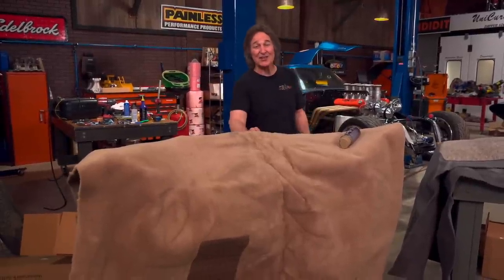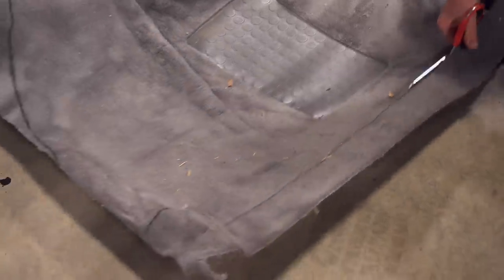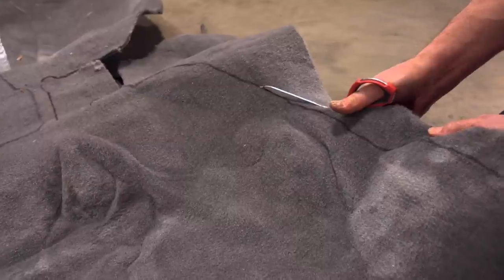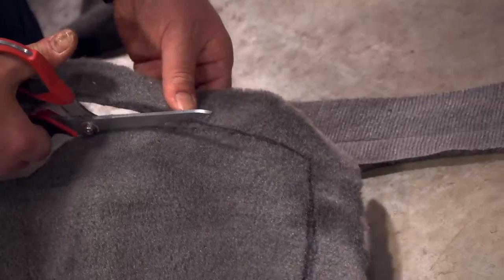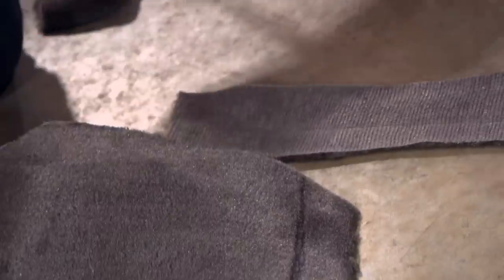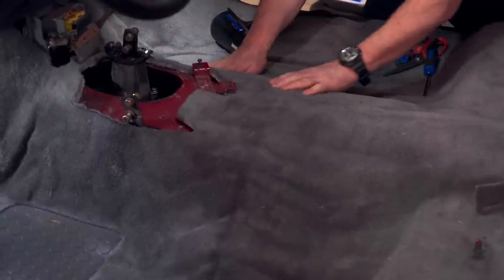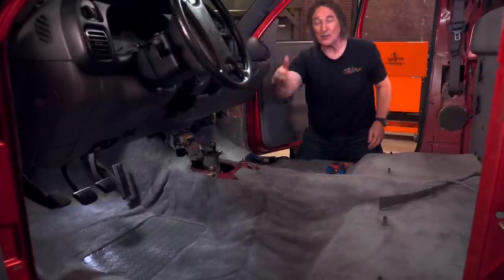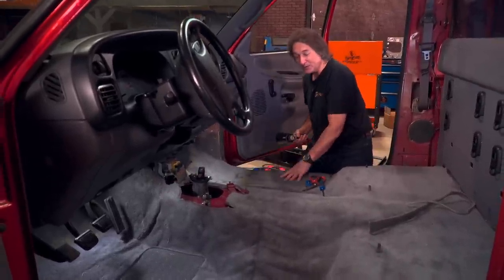This is especially important to consider if you're changing your seats. Fitting a new carpet is pretty straightforward — you just use your old carpet as a pattern to get your preliminary cuts. Then it's just a matter of laying it in place and doing your final cutting and trimming for the seat belts, the shifters, and the seat mounts. Once you have it trimmed and fitting well, you're pretty much done. Don't be too concerned about wrinkles — they will naturally work themselves out, but if you want to give it a helping hand, grab a heat gun, heat the back side of the carpet, and that'll help work out those wrinkles.